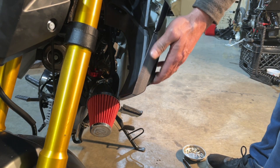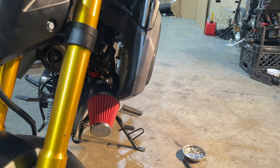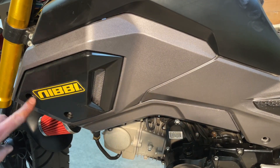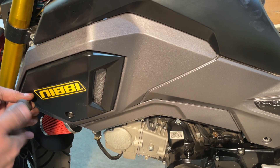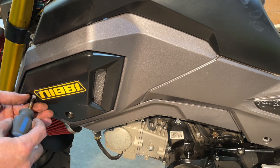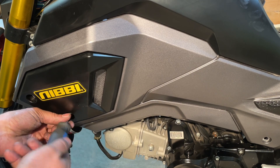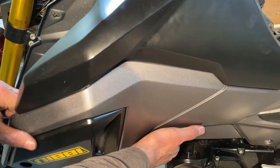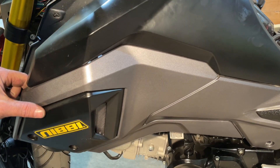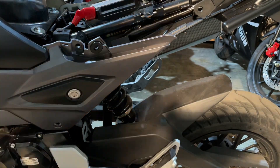I'm going to look down there. There are two screws I forgot to remove — sorry about that, right here and right here. Now this fairing is almost ready to come off. There's one screw at the back that has to come off, and then this fairing will come off and we can take the lock off.